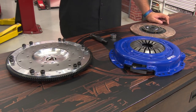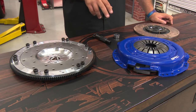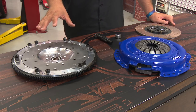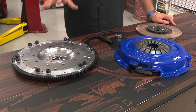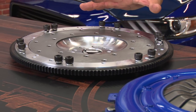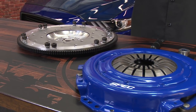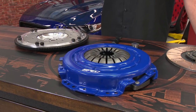The Stage 3 Plus comes with a custom ferro carbon disc and a heavy duty pressure plate, along with the bearing and the installation tool. To make the engagement a little bit softer, I'm going with the aluminum flywheel. This is an SFI spec flywheel — the aluminum is less rotating weight but also provides a softer hit, which is good for the factory transmission. The flywheel is a direct replacement and SFI certified, so it is legal for racing. This clutch will hold up to 850 pound feet of torque, which gives us room to grow in the future.